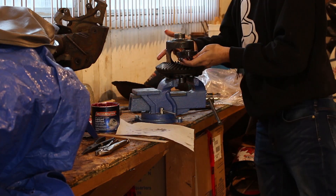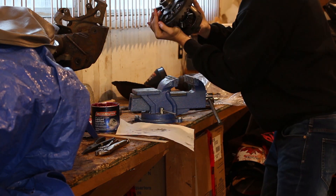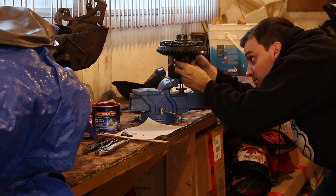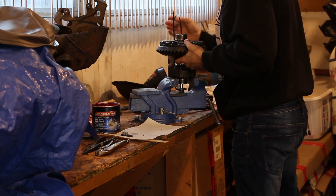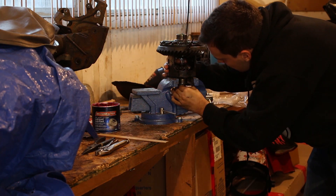Put a dab of grease on the clip so they stay in place while you load the side gear into the carrier. I used some zip ties to hold the top side gear in place so I could snug the nut and bolt on the opposite side before flipping the carrier over.